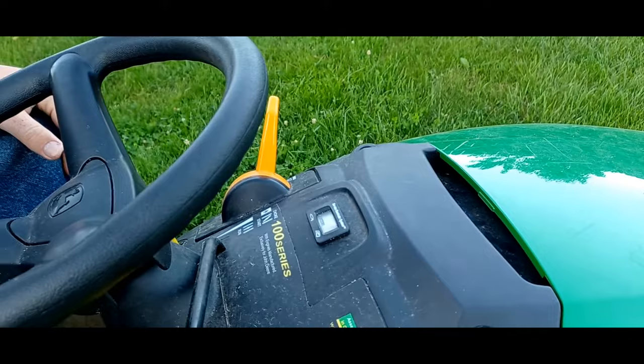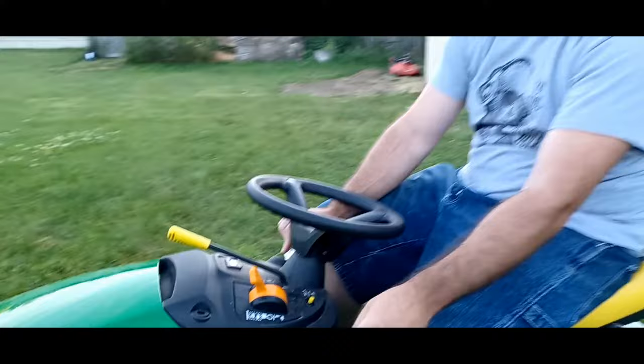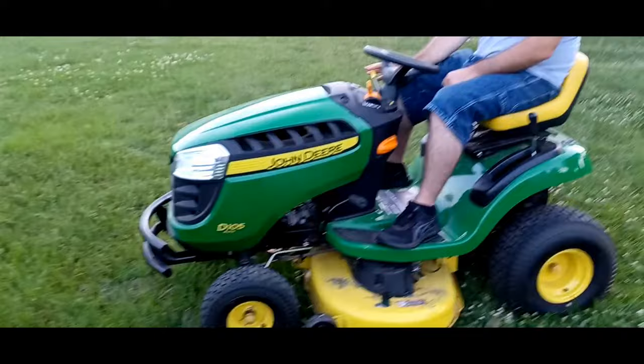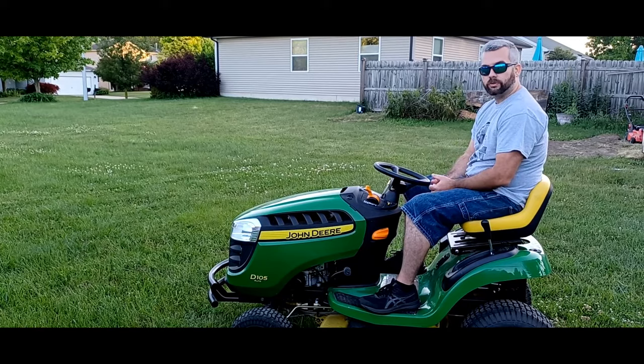We're going to make sure again, verify that your blades are off. Now, most lawnmowers have a safety, and I'll go ahead and explain that to you. The blades are now engaged, and if you see, I press the brake, nothing will happen. So if I disengage the brakes, or the blades, sorry, and disengage the brake, again, nothing will happen. So there are some safeties. Now, older lawnmowers, or possibly if you bought a used mower, they may have disabled some of those safety features. So it's up to you, the operator, to make sure you're being as safe as possible.